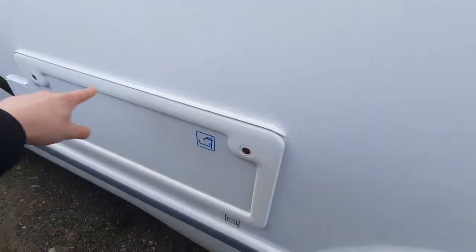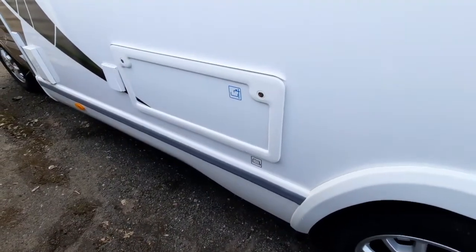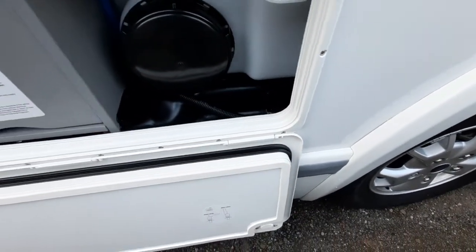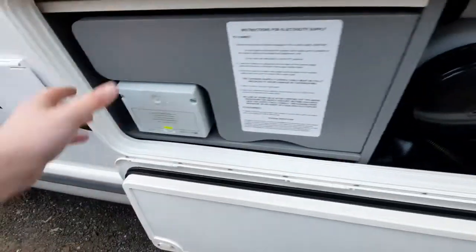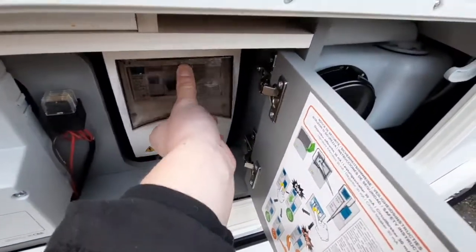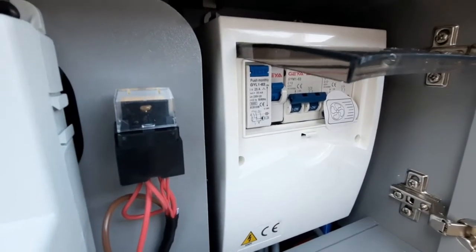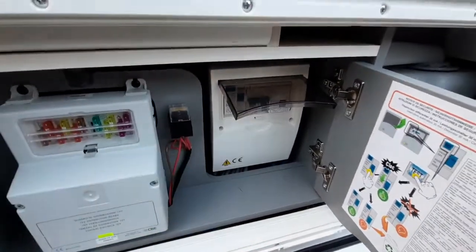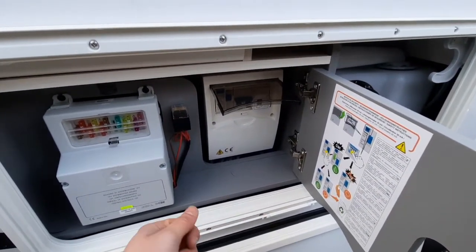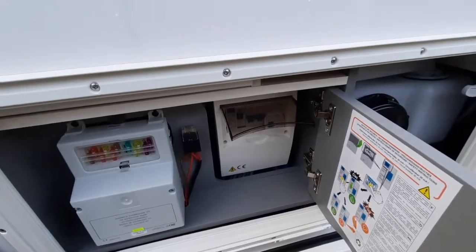Coming round, you'll also find another locker here with a sticker indicating a drain down point. With the locker open, you've got your fresh water tank — as indicated by the sticker, this is your freshwater drain down point. At the side, you've got where all your electrics are located: your fuses in one box, and your RCD breaker in a second. For your RCD breaker, if the vehicle ever trips, this is where you need to come. There's a little test button. If you can't get any power to the vehicle, click that test button — if this box trips, you know you're getting power to the vehicle, so it's therefore not a fault with your cable or a site fault, it's a fault with your vehicle. From that point you can then check your fuses.